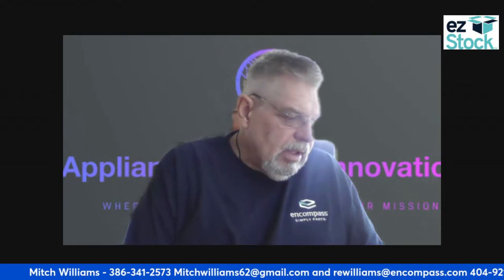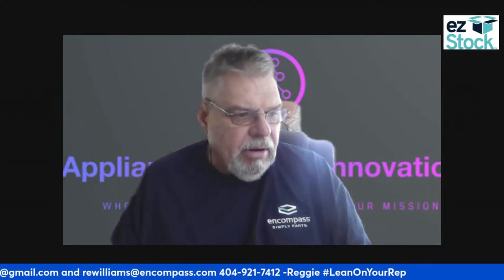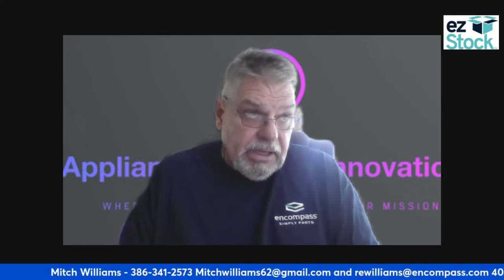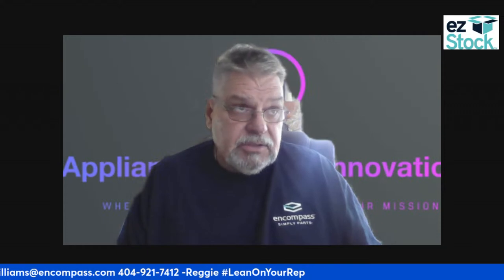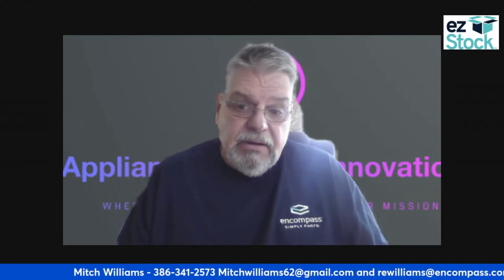I was there at Encompass whenever GE came and did a train the trainer, and the Encompass refrigerator needed an update. So he did it right there while we were doing it, showing us how it updated the system. And he was stating that sometimes that's all you need is an update, that's why you had this weird problem. So by me plugging this machine in, I can actually have the ability maybe to fix the problem without ever having to do anything else. But it will tell me if I plug it in, it tells me if it needs an update or not.